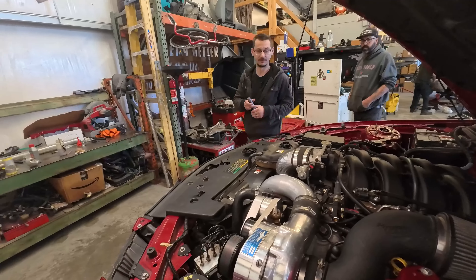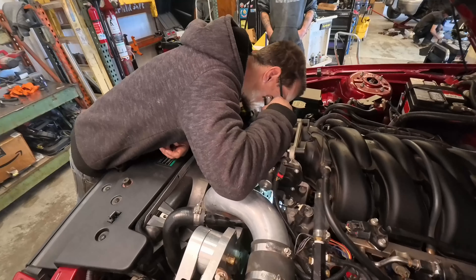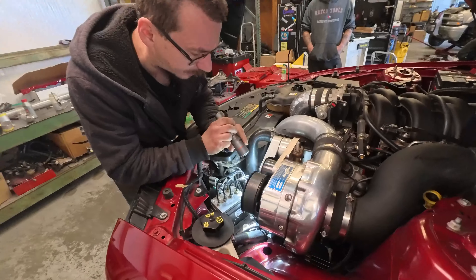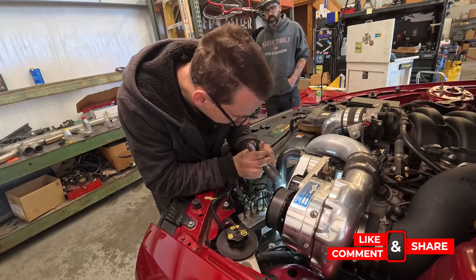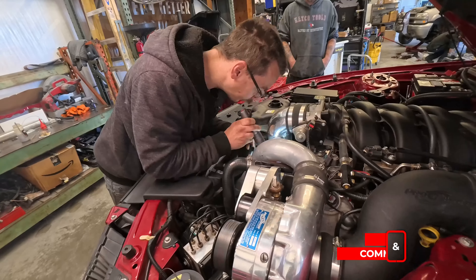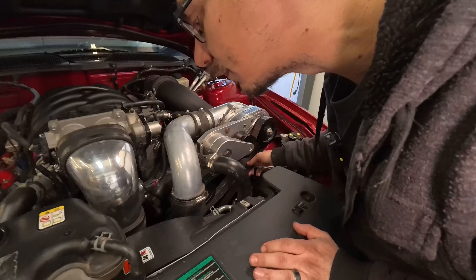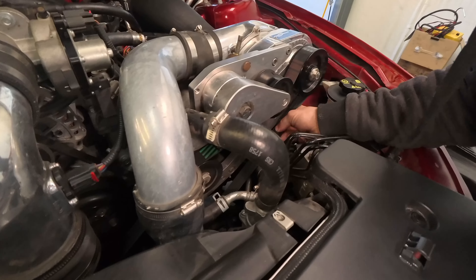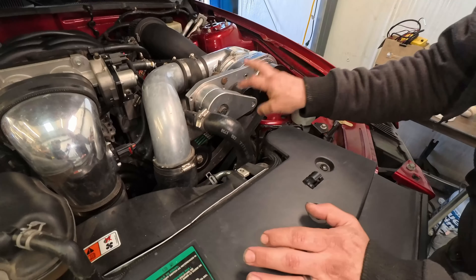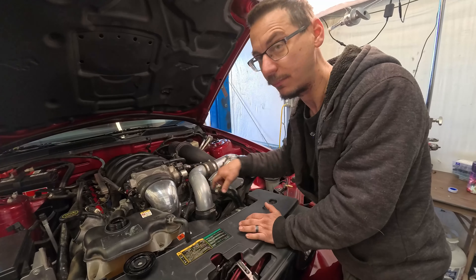Where's my flashlight? I can definitely tell the belt is loose - it's sitting here flapping away. So essentially I'm just going to take this belt off, which is definitely loose. I heard something creak under there which I'm not happy with, but the belt being loose isn't helping. I'm going to take the belt off, turn it back on, and see if we still hear the same noise, because I think it's actually a pulley behind all of this.